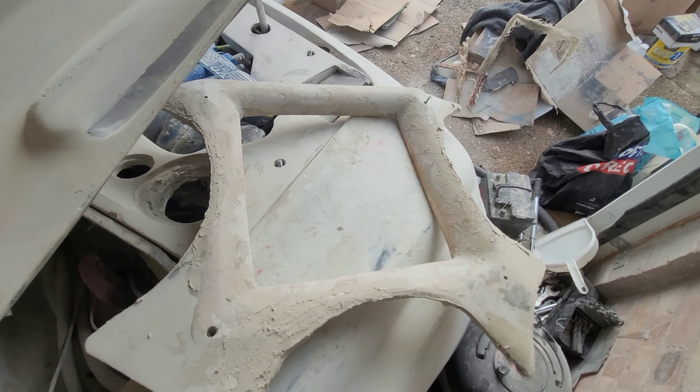This is the section where the trim panel normally goes — that's where the tablets mount and things like that, so I've taken all that out while I'm working on it. The main thing I'm going to be doing this week is fiberglass up here to get this all flat and nice. I'm also going to cover everything up so it doesn't get damaged. This whole plywood section at the top is going to be fiberglassed for a bit more strength and blended in. At the moment it's not actually attached properly at the top — you can see the plywood going into the car — so it just needs cutting back, bonding together, same on the other side.